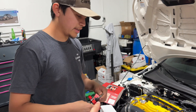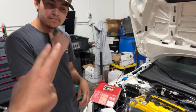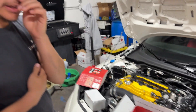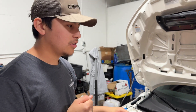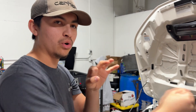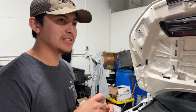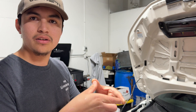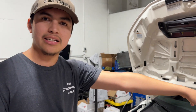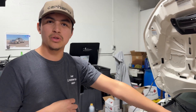This is also going to delete that pesky second gear grind that a lot of you guys tend to feel when on track or even during lockouts. In the FK8 I felt the second gear grind and also the fourth-to-fifth gear lockout once or twice. That happens when you're doing fast shifts — you're pushing the clutch in, but because of the delay valve, there's a delay between the pull and the shift. Deleting it gives you direct fluid response.